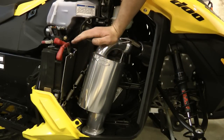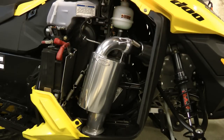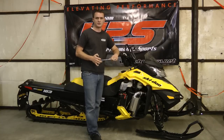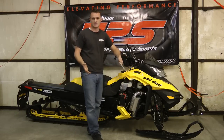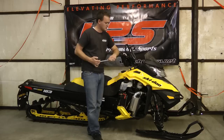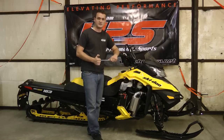And that is how you install an HPS silencer on the E-Tech motors. This particular muffler was very unique to design. It still has the dual chamber double walls like the other mufflers we build, but it is an oval. We felt that was necessary for the E-Tech motor to keep the HPS signature sound but keep it within sound regulations. It also allows us to build a lot of performance into your motor — it kicks on really hard in the mid-range and builds at least three and a half horsepower on the top end, while saving twelve and a half pounds from your stock muffler.